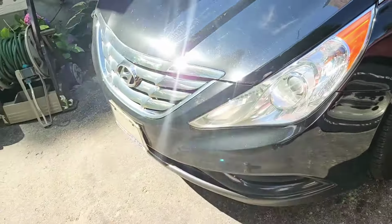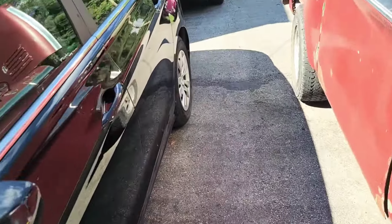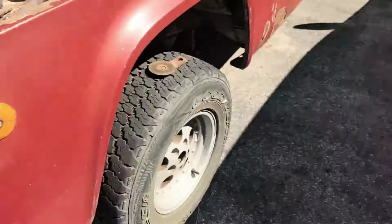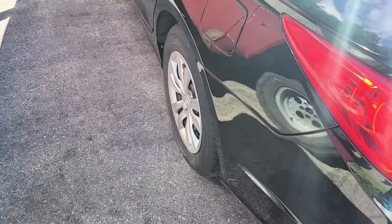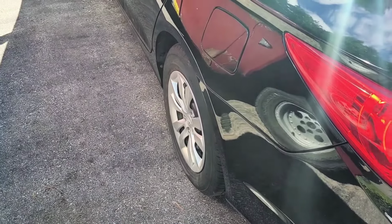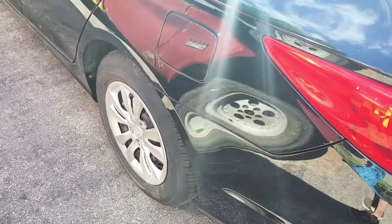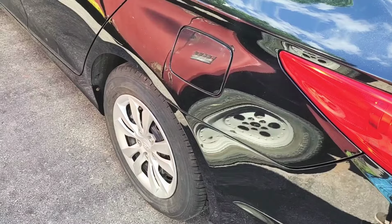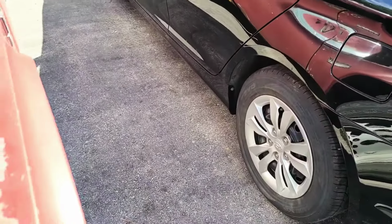Doing the rear calipers on this thing. Took the brakes about a year ago, but I just let it sit. Didn't drive it at all. So now, the rear calipers are seized up, and we gotta replace them. I tried unseizing them, shooting some lubricant under the boot, and working them in and out, but it didn't work.